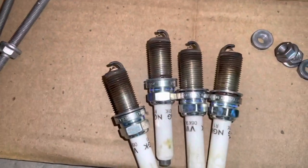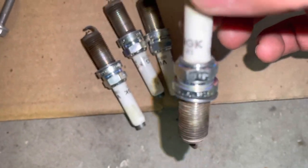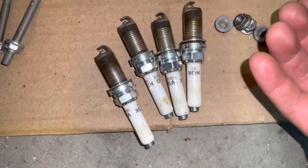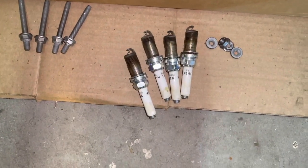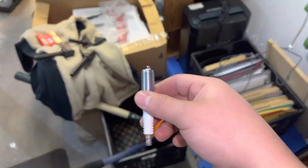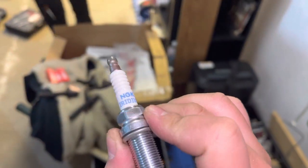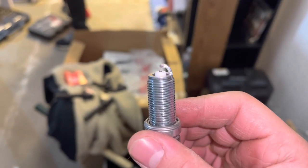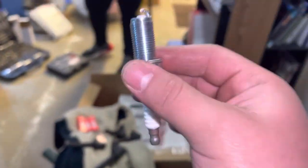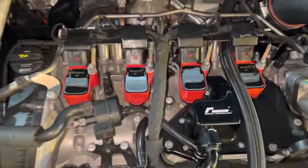Alright, all four plugs are out. I didn't even know that these were like factory NGK already — that's pretty cool, because normally I would expect factory Denso plugs. So let's get the new ones in. The homie Mondo showed up — we got the new spark plugs, the NGK, part number I showed y'all already. These are supposed to be gapped at 0.024; we just checked and it's all set, so we're gonna toss it in the car.